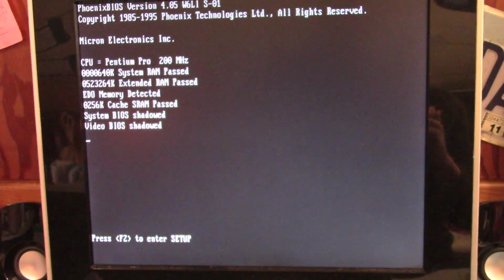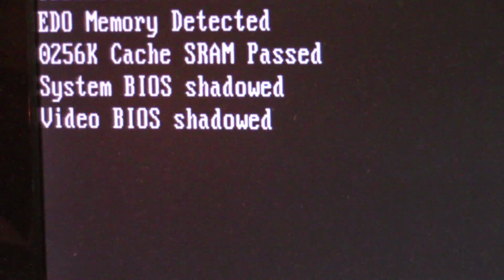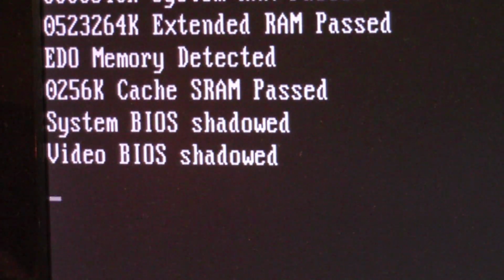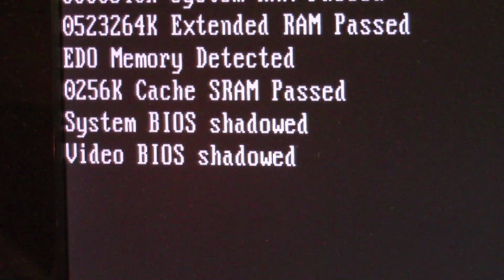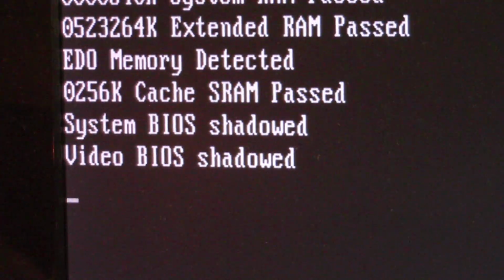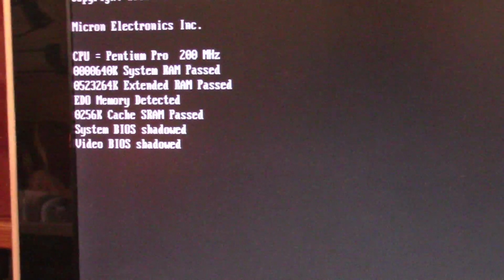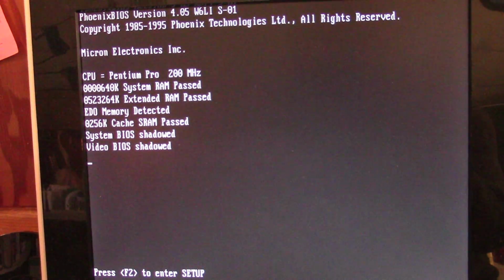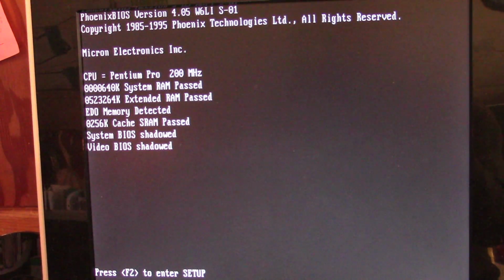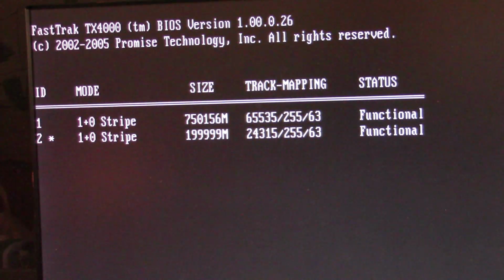Right, here it will pause a bit, trying to identify the boot cards, the PCI cards. It seems to be misidentifying the amount of level 2 cache the CPUs have. However, every other metric properly recognizes it. I don't know if the BIOS is limiting what the computer has access to. It'll stay here a while until it tries to boot the first card in order, which is the IDE RAID card. Here we have the RAID card attempting to boot.